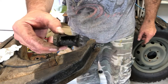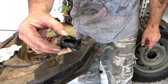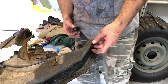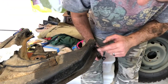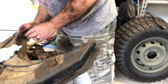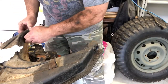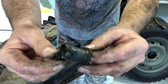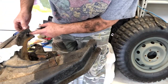Look at that - that's where the bolt started wearing itself through. You wonder why there's clunking going on in the rear end. Fortunately, that bolt did not rub through into the outer sleeve, so we don't have any damage to the A-frame - thank God. The rubber's definitely dry rotted. Same situation - wore out, but we're safe.